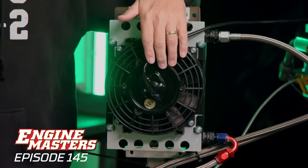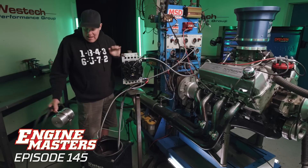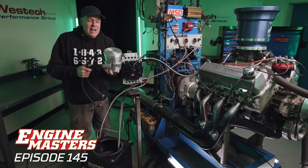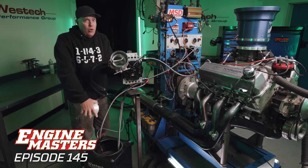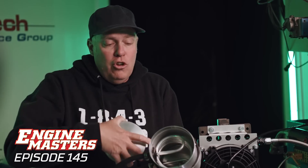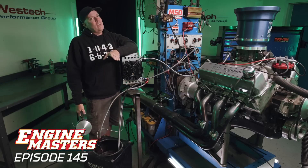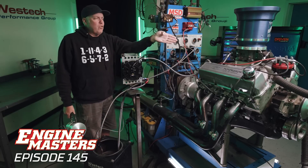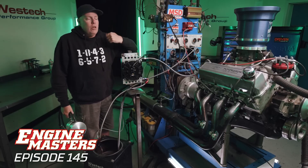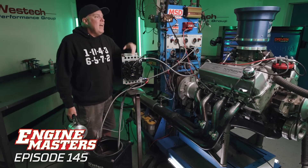Now let's talk about the cooling. First, we have this transmission cooler with an integral electric fan — an awesome way to cool fuel if it actually works, because you don't need to change ice or anything like that. We're also testing a typical old fuel cooler that does take ice — a can filled with coils, the same concept as how we're heating the fuel. And the last thing is probably impractical for an in-car application: we're going to take a CO2 bottle, discharge it directly at the carburetor bowls, freeze them if we possibly can, and then run out of the room and make a pull.